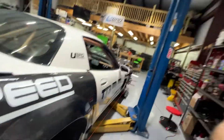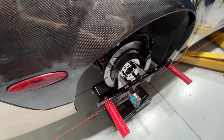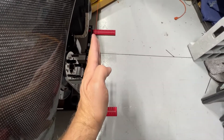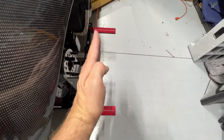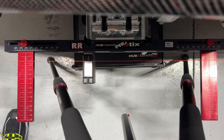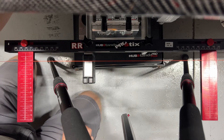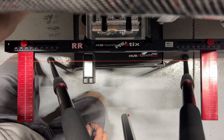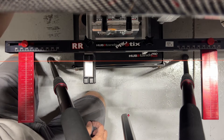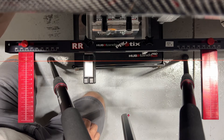Let's adjust this side. This one is also 21-21, so we're going to turn this in. Basically, we're going to take the wheel and turn it in — not dramatically, just a 3-millimeter difference. You probably won't be able to read this number because the light's glaring on it, but you'll see the ProStick move, and we need to go in. This is going to be a clockwise turn — going to about right there. That's 23. Tighten up the jam nuts, and that's it.